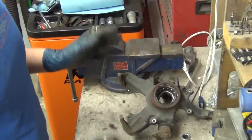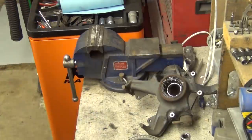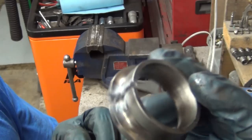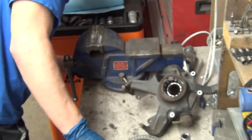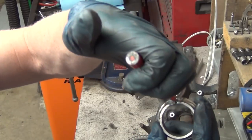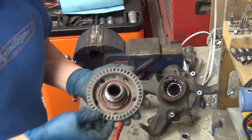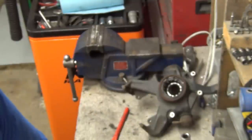The next part's the hardest part of the teardown, in my opinion. You've got to pull out this little snap ring. Let me show you what one of these looks like once you've cut it off. It should look something like this — you can see where I've just burned through it. I didn't go crazy berserk; just enough to get it to split. The slag from the plasma cutter was still connecting it, and then you take a chisel and run it down this way to get it to pop. Once you've got it to pop, it'll just slide right off. Normally you'd use a device that comes in sideways to draw it off, but you just can't do that because of the exciter ring — it's just a Volkswagen oddity.